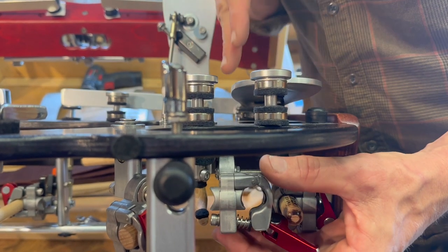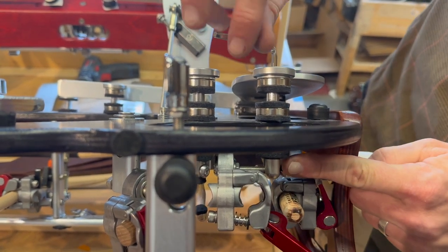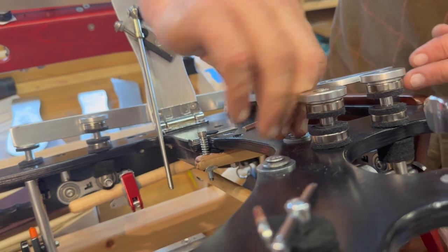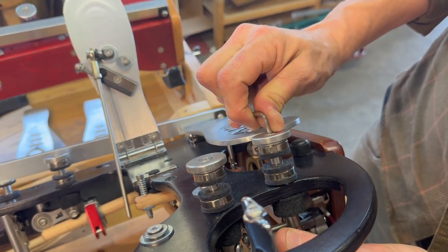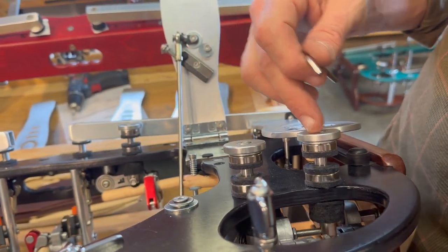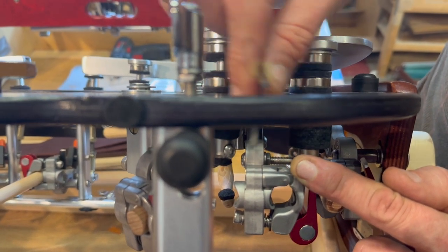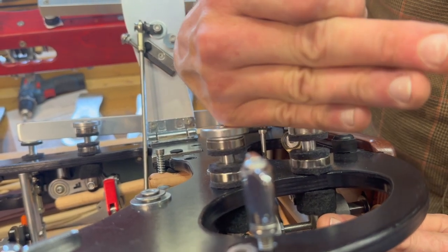I'm feeling pretty good that that's pretty perpendicular to everything. So I'm going to learn from my mistakes - I'm going to tighten this down first. It's pretty close to the edge of that bolt, but it should be pretty good. I'm going to go pretty tight and get a nice good free motion. Now I'm going to tighten up the mount about as hard as I can get it. That is looking pretty smooth. I'm going to take my final turn and recognize I just put in my left outer toe post, of which you can make this toe post switch by using a hex 10mm Allen wrench.